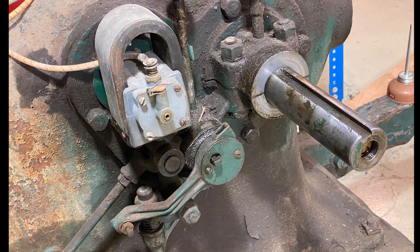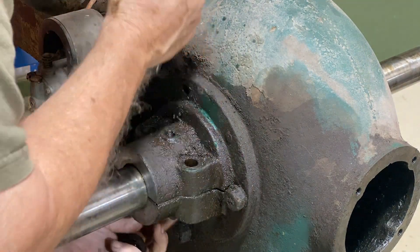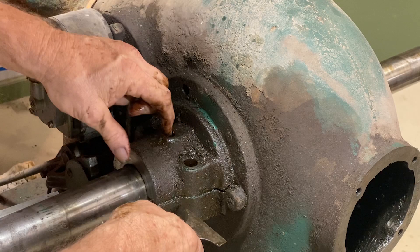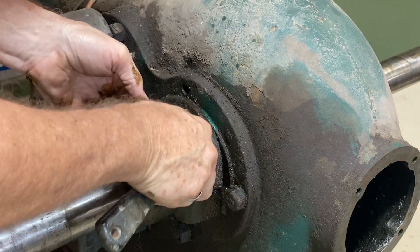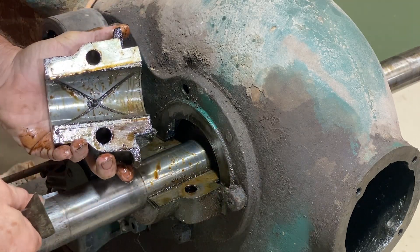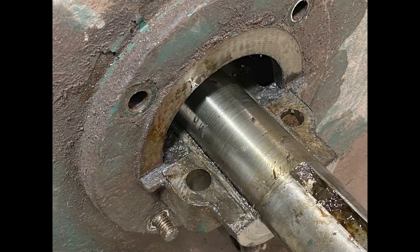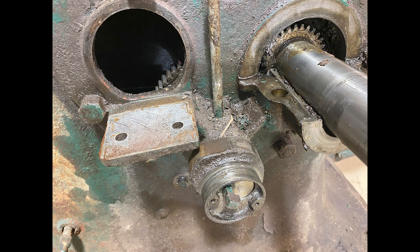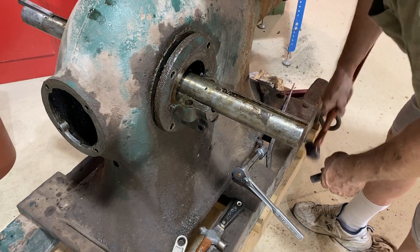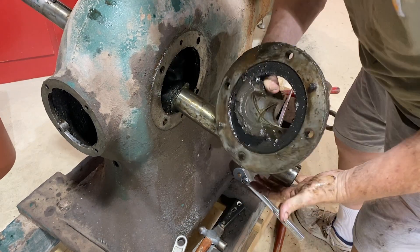And the crankshaft. But first, I made more pictures to help me keep things straight. So away we go. Removing the bearing caps was pretty straightforward. Be careful with those shims and try to keep them in order, right and left. I removed the connecting rod, bearing cap, and shims, but did not pull the piston out at this point. The engine hoist was called back into service to hold the crankshaft while I removed the governor-side cover. The magneto-side cover must be removed in order to get the crankshaft out of the block.